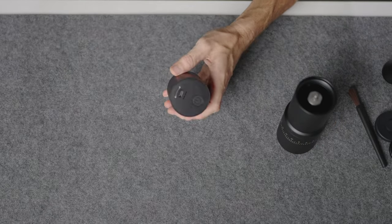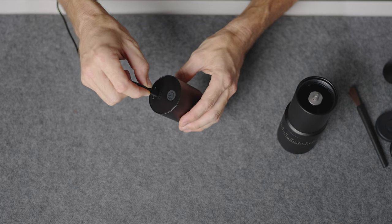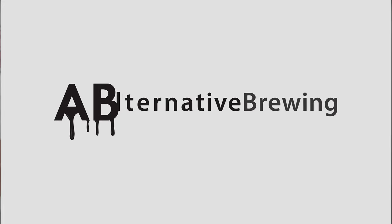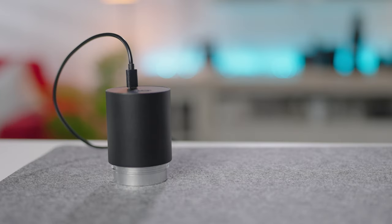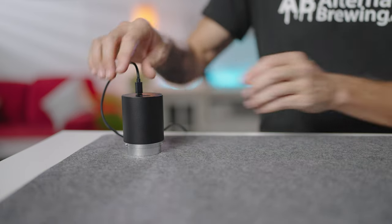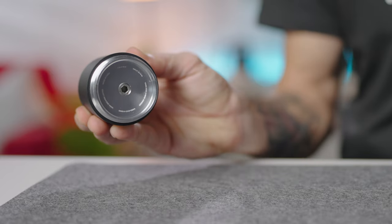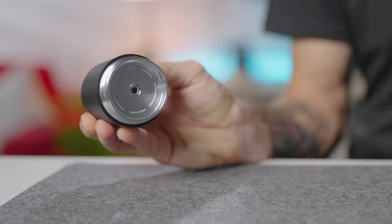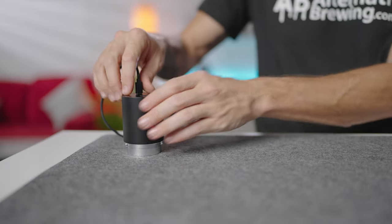Let's throw the motor on charge and discuss some of the best-known features of the Varia Evo Hybrid. The motor has a 7.4 volt, 800 milliamp hour rechargeable battery using a USB-C charging cable, with a 40 watt power output. Additional features include an auto-stop function — you can turn this grinder on and walk away; it will turn off automatically once all the beans have passed through the burrs — as well as over-torque protection, so if you get a rock in your dose, the motor will switch off automatically rather than breaking.